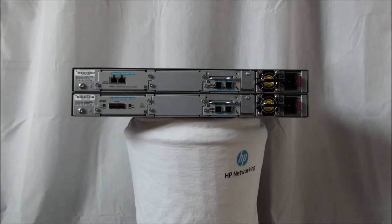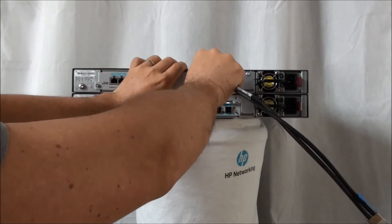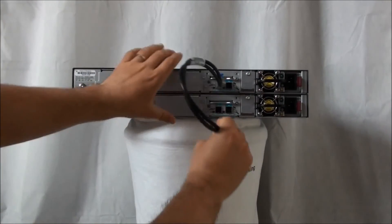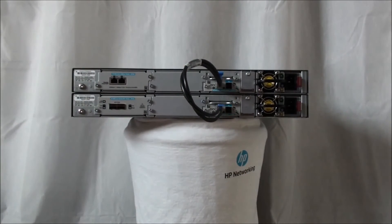In order to obey network topology and protocol rules, one fragment becomes inactive. For these reasons, chain is not recommended as a topology. Let's see how a chain topology looks: we install the stacking cable until you hear a click, and we also install it in the outer port. This is a chain topology — if you have more switches, you will end up with an open-ended chain.